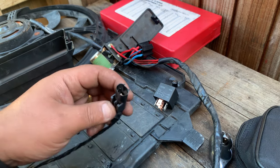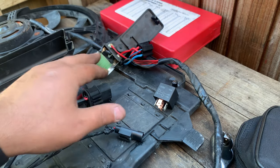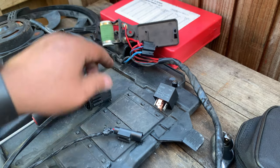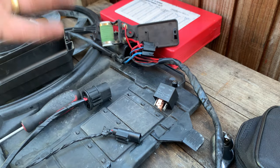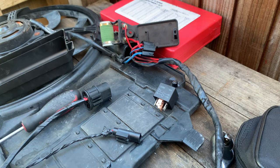I just need to fix these pins here - hope I don't break it - swap the resistor. What I'm going to do is cut this wire here, connect the new motor, solder it, put some liquid tape on, I've got some cloth tape as well. Do a tidy job and it should last.